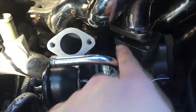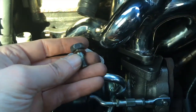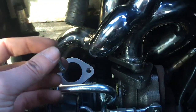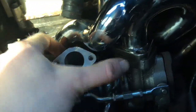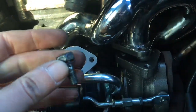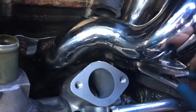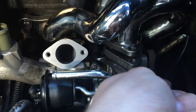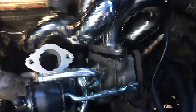And now for something equally frustrating. A bolt has to go in there — it's an oil line. Basically oil goes in there and comes out the bottom. To get that in there, you just have to keep it loose, otherwise you can't thread it with your hands. If you tighten it up first you can't get your fingers in there. So thread it up as tight as you can while it's kind of loose, then mount the turbo to the header. On the new turbo, the hoses are in a different place, so if you go to tighten it you can barely get in there. But it's in — it's going to fit.